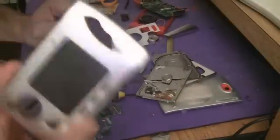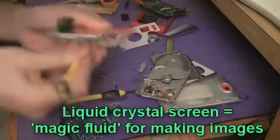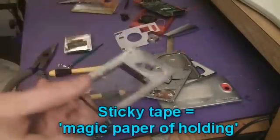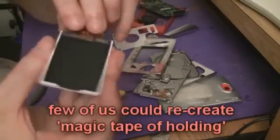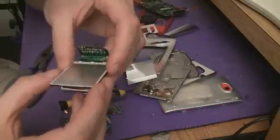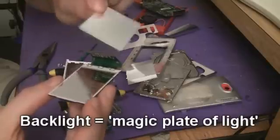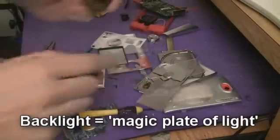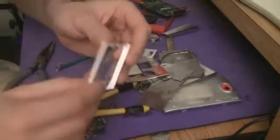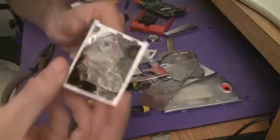Which leaves us with one last goodie — the screen. Liquid crystal screen. The whole thing's only just held in with sticky tape. So you've got a plastic screen on the front that gives it some protection. Then you get into the rest of it — this is the LCD screen itself. But the backlight is the only thing that actually runs under any significant voltage. That's polarized. So all that I stripped away there was the backlight. There's the LCD display — if I actually move it up, you'll see even better that the LCD display is actually completely transparent, and then you've got a backlight on it that helps you see it. They usually require some sort of insulation because they run at quite high voltages, and they're quite well mirrored as well.